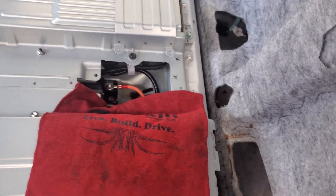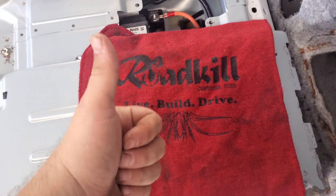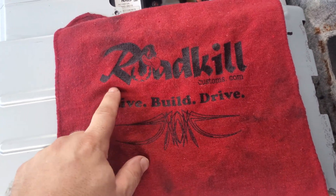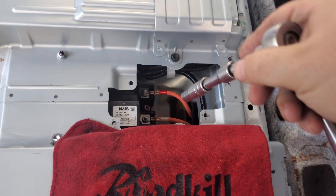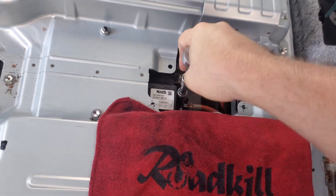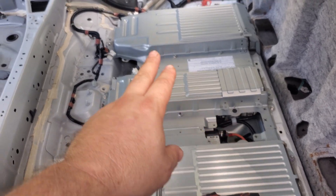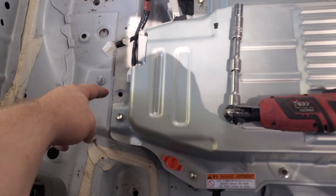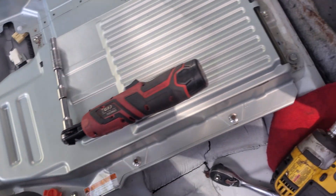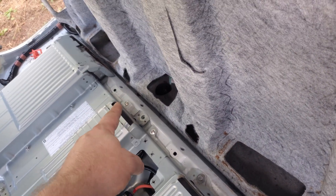I've got a double extension so we're not touching the sides, and I've got my safety towel here to make sure my tools don't contact anything. These terminal bolts are 10-millimeter. Now that's disconnected, we go around and take out all the bolts around the outside — those are all 12-millimeter. There are also two 10-millimeter bolts at the front you take off to get to those 12-millimeters, and a little cap to get off there.